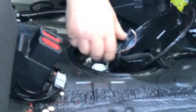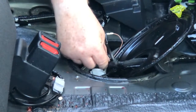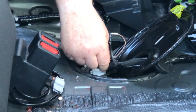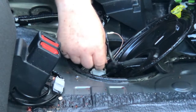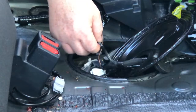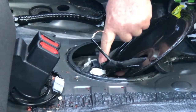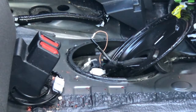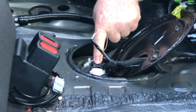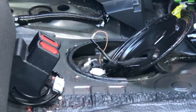As you'll notice, we've got a little black wire and a little green wire, a little blue wire. Those are the three phases. And this little brown wire with a little splice connection right here — that's a shield. So let's go ahead and do some diagnostics on it. Instead of back-probing here, let's go to the part of the car that controls the wiring and the flow of current — the fuel pump control module.